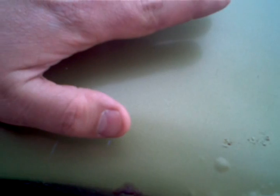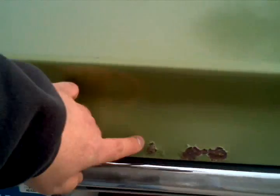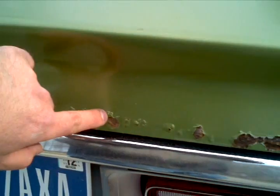That's the lip — you can see it bubbling. The guy put factory full quarters over top of the original quarters without cutting them off. I scratched my head on that, but I can show you there's a row of pop rivets right across here the whole way where he did that and then bonded and body-filled it. The trunk lid has some hash here — it's not really through, but it's there.